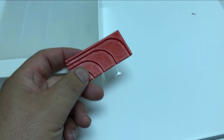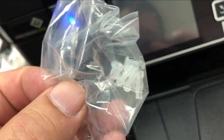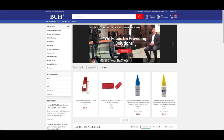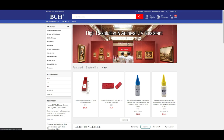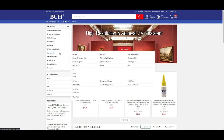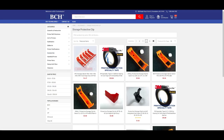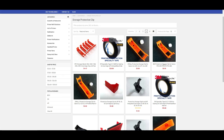This is what a tank and a bracket look like. Elbow and sleeves. Other than that, you need a flathead screwdriver or butter knife, and some kind of heating source such as a stove or a torch. Also, if you don't want to get ink everywhere, you'll need a pair of gloves. Another very important thing to have is the protective clips. For those, go to accessories, then storage, then protective clip. Based on how many cartridges you have, you'll want a big one and also pick up a couple of small ones.